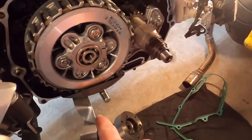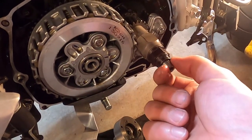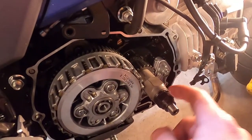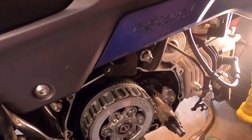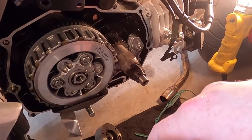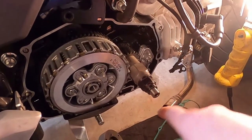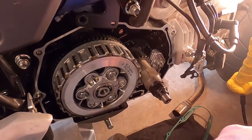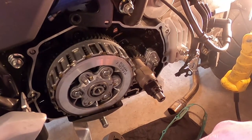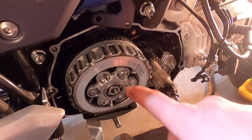All right. And this is that other hole where I said we need to put oil. This bottom shaft around here, make sure you torque that. We're going to put grease and some oil. Well, oil. In these places like this. I mean, worst case, you can put your finger in the used oil and just wipe it around. We need it to be lubricated before it builds up oil pressure, so nothing has any premature wear. So that's where we're at.